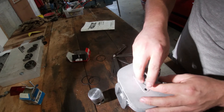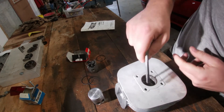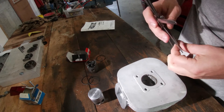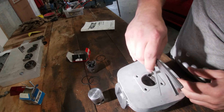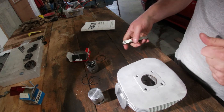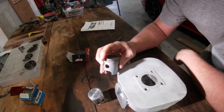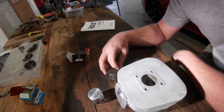And maybe then find the correct piston rings or not — I'm not quite sure. I'm going to give the guy that ordered my piston rings a call and see if he can find other rings. Let's see what this second piston ring tells me about the gap. 0.95 — one millimeter. Yeah, this one doesn't fit, so 0.95, which is way too much. So these old piston rings are definitely toast.